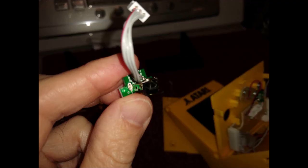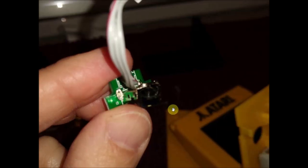So once you pull it back, this is our culprit right here. This right here is, I'm going to pull that in a second. It's actually a ring with a notch. And that notch is what locks into all these other grooves. Once we take that out, this will become a smooth turning spinner. So again, the metal gets pulled out. I have another picture I think is better, but I just bent these out and pulled it back a little bit just to get access to this ring.